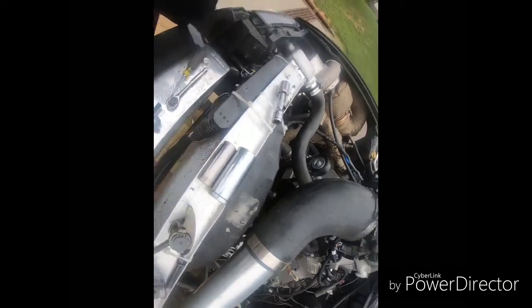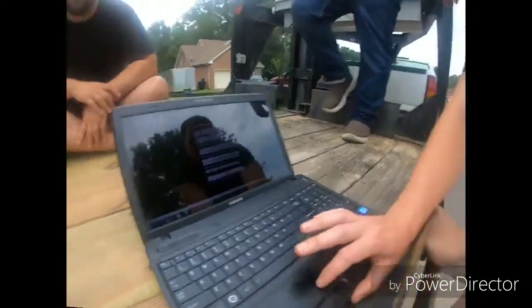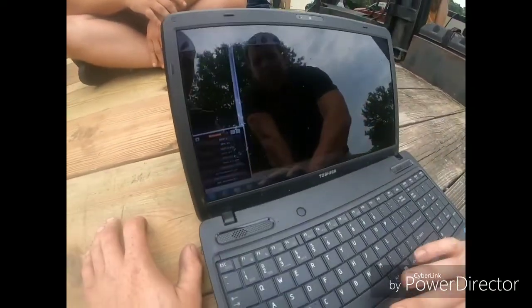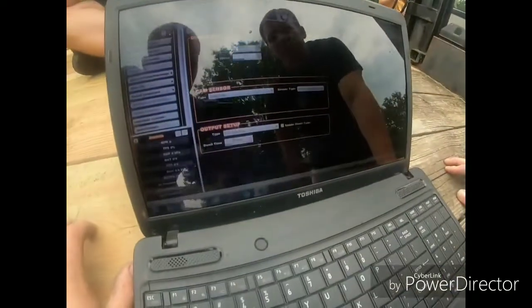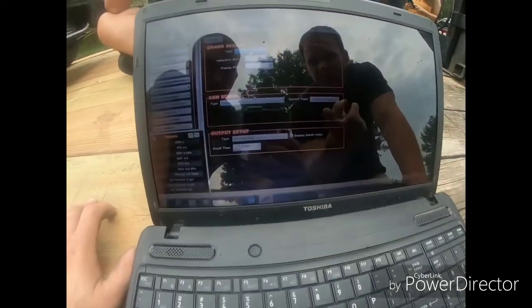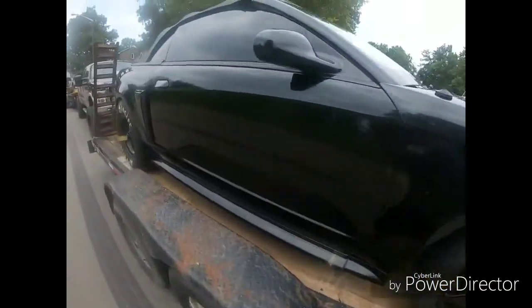Alright, we verified timing with the light. Can you see the computer on there? Yeah, it'll work. We had to go set up a custom ignition table to set this up. We configured the custom settings and set the offset of the timing. It was advanced one degree, so we pulled a degree out and put it right on — right on with what we wanted to see. It's all back together and it starts up.